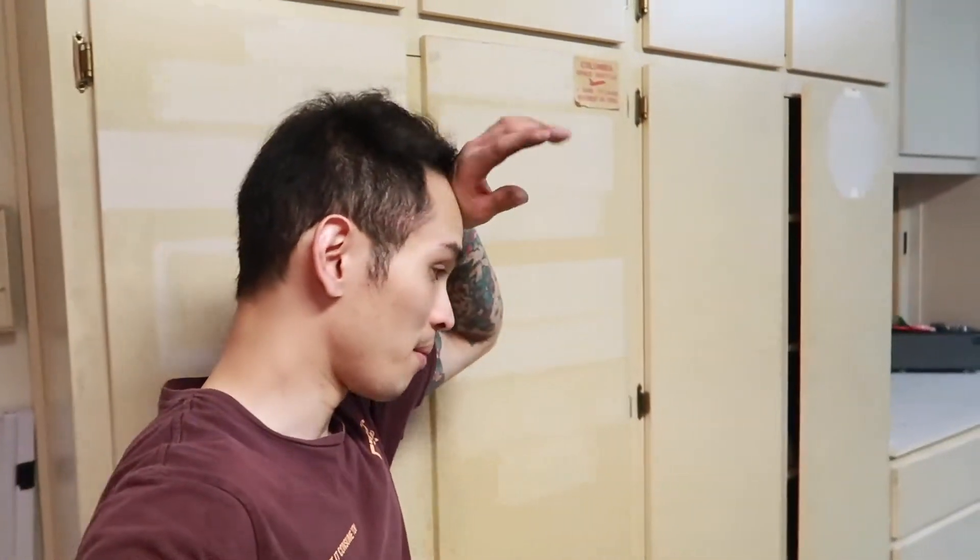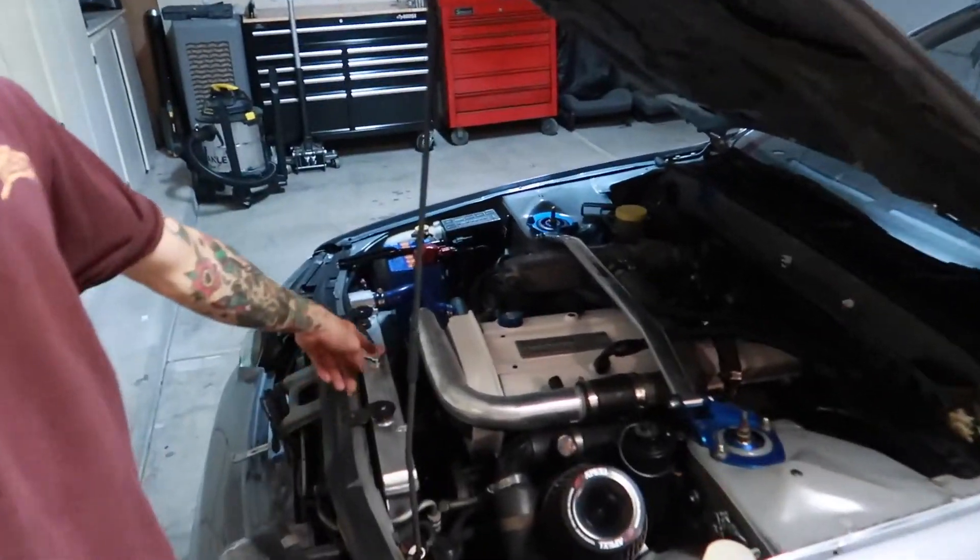Let me know what you think in the comments below. That is going to conclude this video — thank you so much for tuning in. I have a lot of content, I just don't have a lot of time to execute it, but I'm doing my absolute best. I'm a little bit nervous about starting the RB20 in terms of the crank angle sensor and timing, but I did my research. If timing is slightly off, I can readjust it and find the indications on the crank angle sensor where the washers were held. Cross my fingers everything works out. Thank you again for your continuous support, and if you're new to the channel, hit the subscribe button — aim high, drive below, catch you next video.